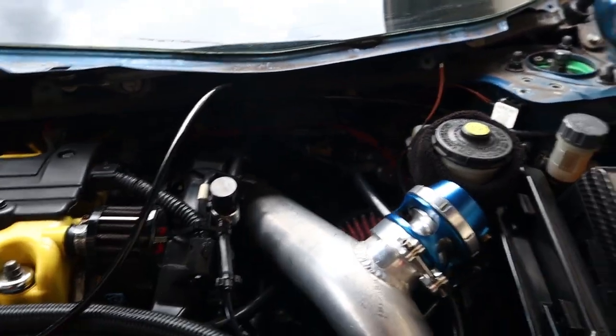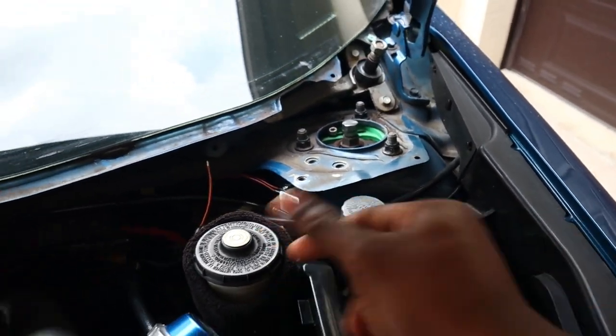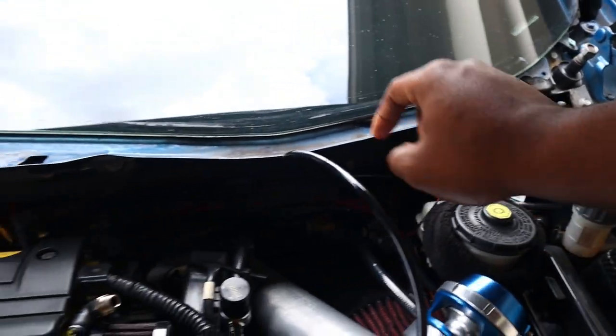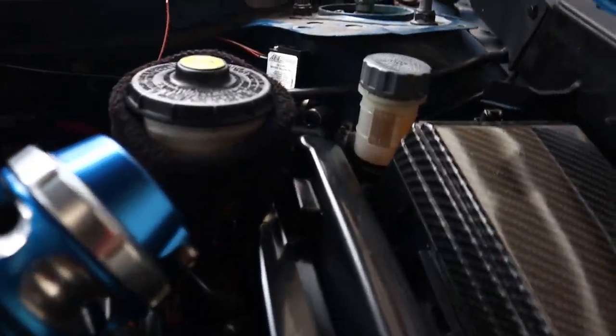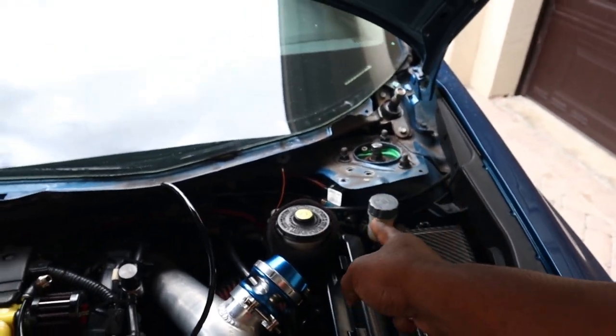This is where I mounted mine — I mounted it with some 3M tape. I might put a zip tie right here and here to connect it to some holes just in case the 3M doesn't hold. I have my line going from here right into the wastegate back there. It's gonna go to the top port. The line coming out — I believe that's port 2 — goes to your top port of the wastegate, and port 1 tees off into your boost reference on the vacuum block and goes back to the bottom of the wastegate.